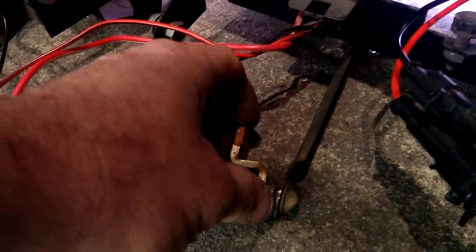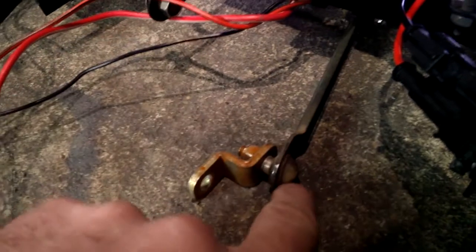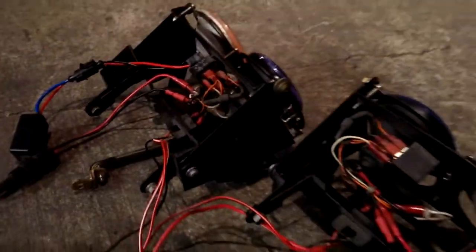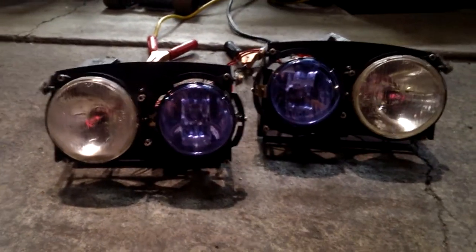Two bolts to the car, four on the lid, and then the one on the motor — which you could actually leave on the motor and just pop the ball joint off, or pop the rod off up there. They actually use stainless steel screws on it too, so it won't rust. So there's the Miata MX-5 Lazy Eye kit — if anybody's interested, hit me up. Until next time guys, AlphaDog Garage, just take it easy.